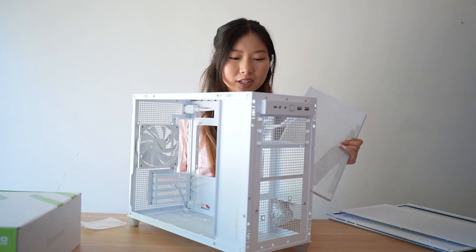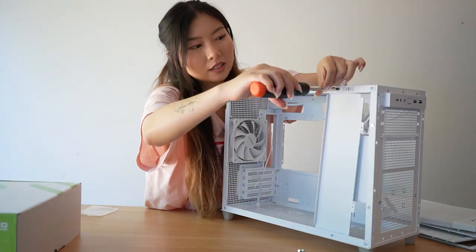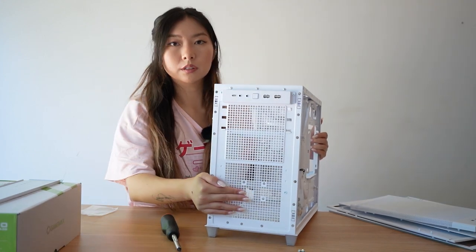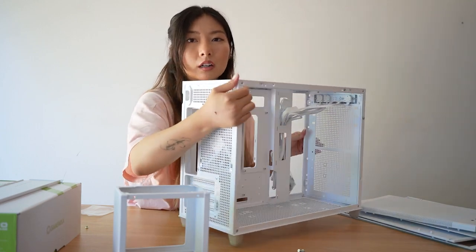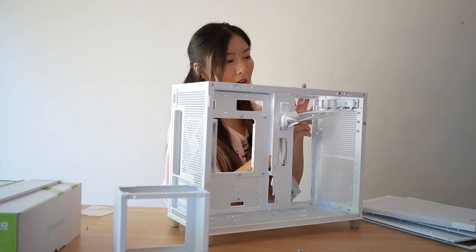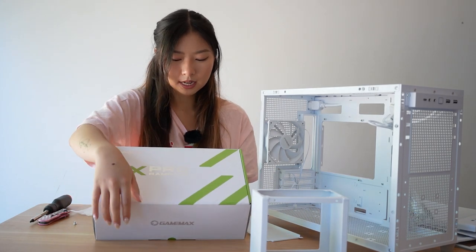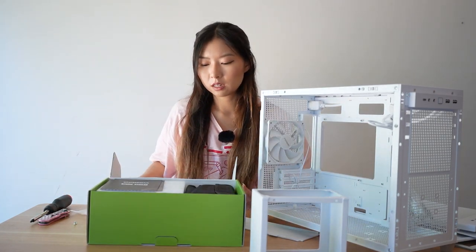You could totally paint this case pink, by the way. To install the power supply, we need to take the front piece off and remove the bracket — two screws — and take the cage out. There are three levels to the cage; if you have a 360 AIO like we do, put the PSU in the bottom one. We have the GameMax Pro Rampage 850W power supply in white, and since you can see it through this case, the white version is definitely worth it.